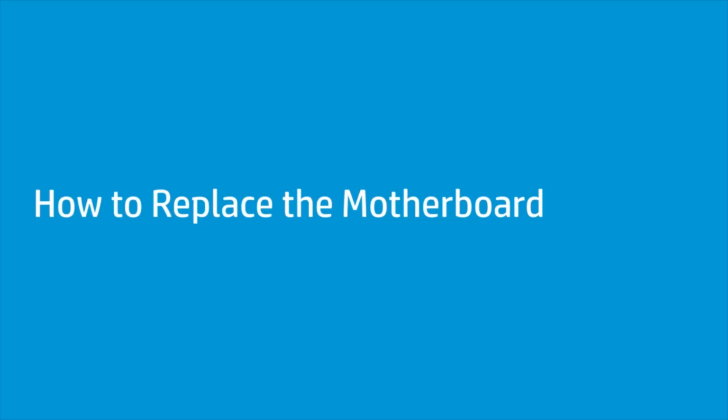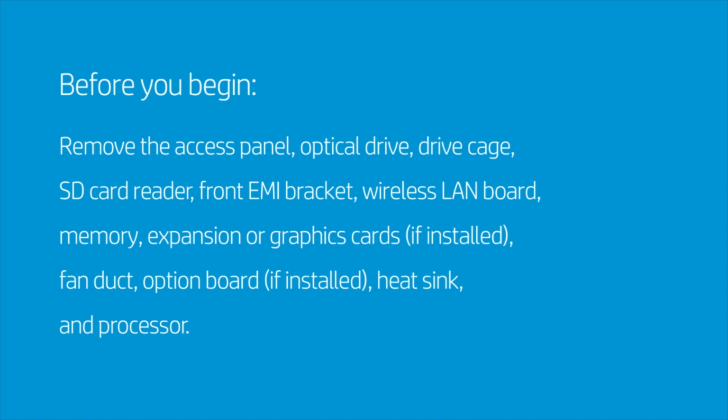How to replace the motherboard. Before you begin, remove the access panel, optical drive, drive cage, SD card reader, front EMI bracket, wireless LAN board, memory, expansion or graphics cards if installed, fan duct, option board if installed, heatsink, and processor.